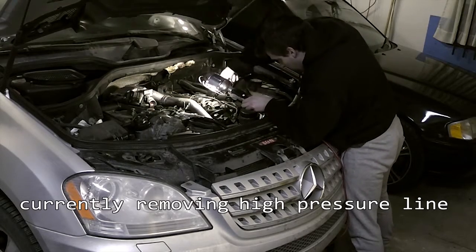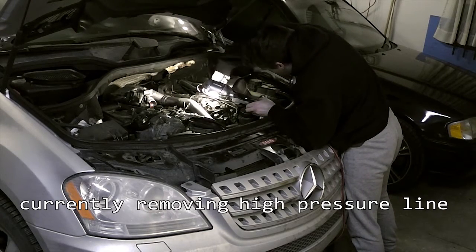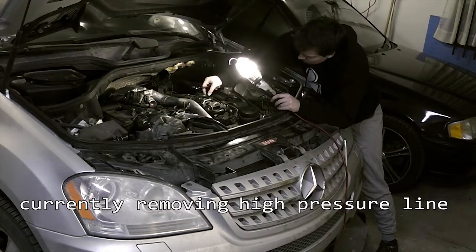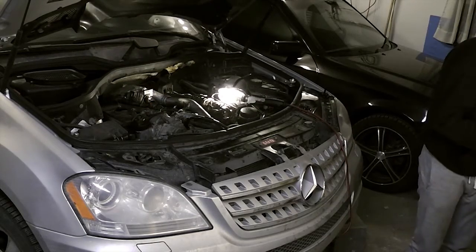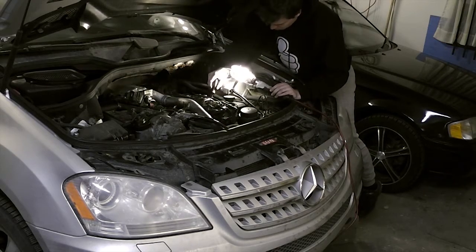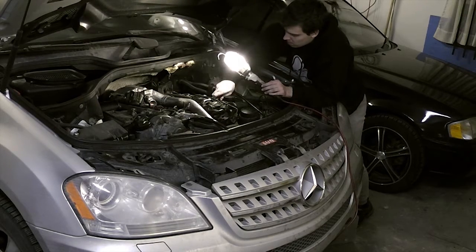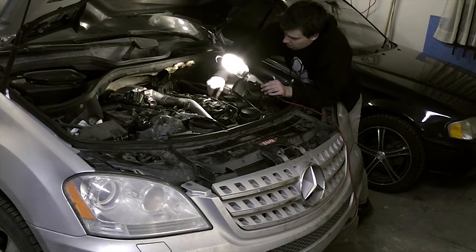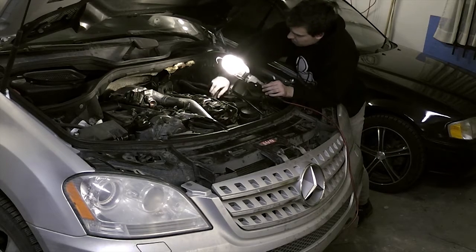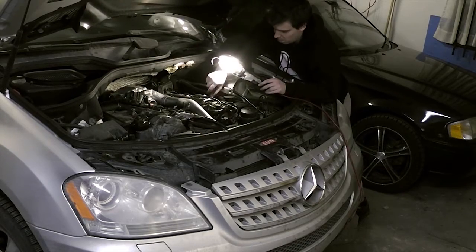Back to that fuel injector return line - if you break it, it's pretty expensive to replace. Here in Canada it was about $275; in the US you can find it for about $100. Honestly, you will likely not be able to remove it without breaking something - the plastic becomes very brittle, and all that black junk that accumulates on it makes it even harder to remove. Each connector has a plastic pressure ring around it which you can pull upwards to disconnect the line from the injector. The old line didn't even want to go back on properly once removed, which would have caused leaks. The new line didn't even take a full five minutes to install and went on each fuel injector with ease. In the end, I'm glad I replaced it - if any other injector starts leaking, at least it will be easy to remove.